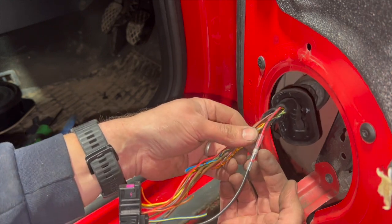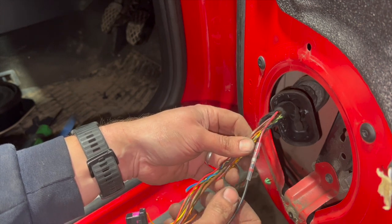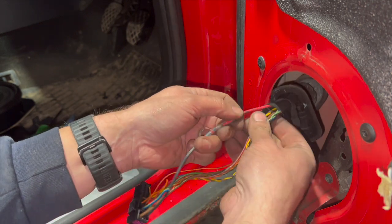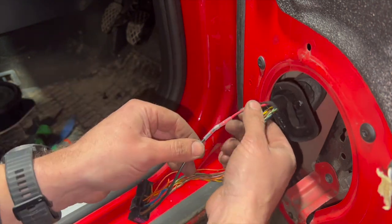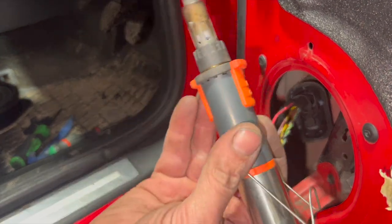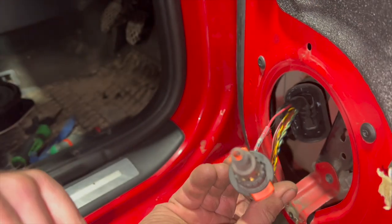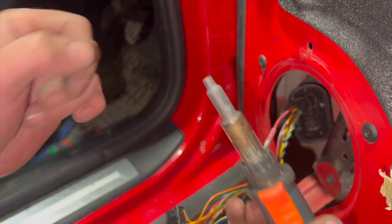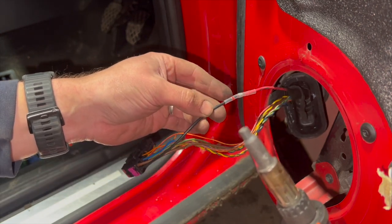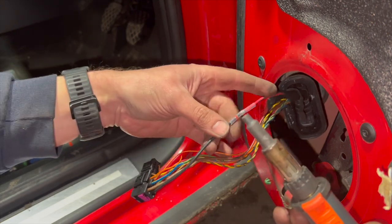Basically I've tried to mesh the wires together in the middle there, and then push the solder over to the centre. And now we'll run the soldering iron, sort of heat gun, over the top of it just to melt that nicely. So using this little gas soldering iron here, you basically take the soldering attachment out of it. It's just like a little heat gun. So we're going to gently warm around the solder now till the solder starts running, and then run it over the little red bands there to seal them up, and that'll do the joint.